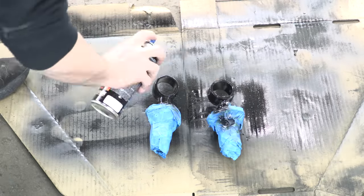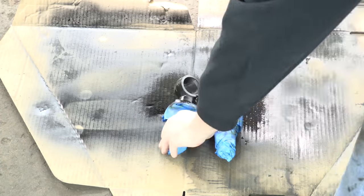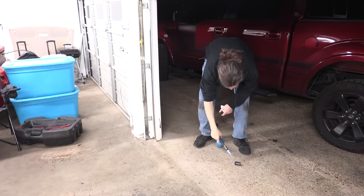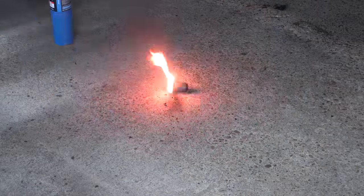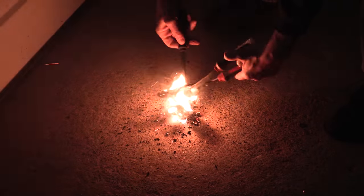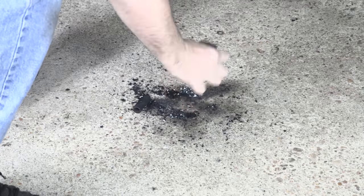While these things dry, I'm going to work on these brand new front lower control arm bushing sets. It just so happens that when I said those brand new clean bushings go right in the trash, I was wrong — I meant they go right in the fire. Turns out you need the outer sleeve for the poly bushing insert; it rides inside the sleeve, so I'm burning the pin and the bushing out so that I can press the sleeve right back in there again. I'm not cooking my brand new control arms. After scraping out all the residue and rinsing it with carb cleaner, I blasted it and grabbed a round file because I really messed this one up trying to press it out using all the wrong stuff.